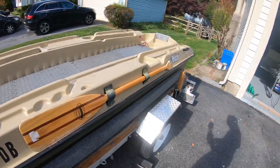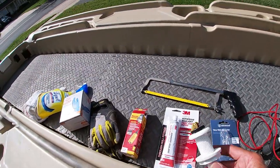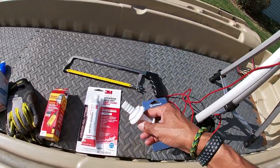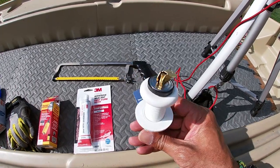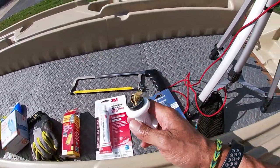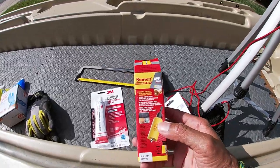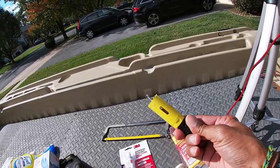I've taken mostly everything out of the boat, leaving the flooring in. First and most important, you'll need some type of through-hole connector. This one is Atwood, model number 3873-3 — I'll link everything in the description below. I'm going with a smaller size to maintain the integrity of the hull; I believe this is a 1 and 1/16th inch hole. You'll also need a hole saw — I got mine off Amazon — also 1 and 1/16th inch.